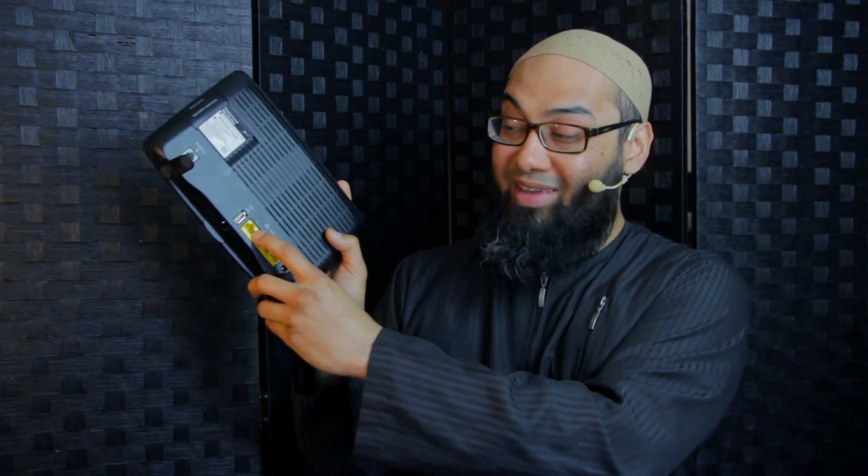You could do that — it has a WPS system, just press the buttons, pair it, calibrate it and Bob's your uncle. The problem is it's quite limited in range and you have to be within the wireless range to boost the signal further. Also wireless isn't always stable. With these repurposed devices you not only get a wireless access point but also extra Ethernet ports for more stable, faster connections. Models of Wi-Fi extenders with Ethernet ports won't be £20 — they'll cost a lot more. So converting an old router is literally free, and you learn some tech skills at the same time.